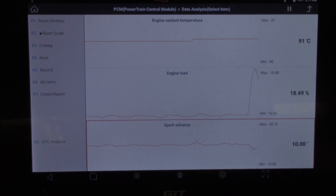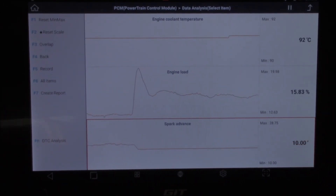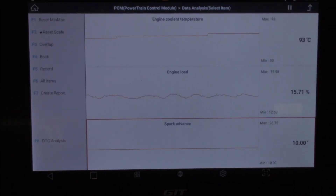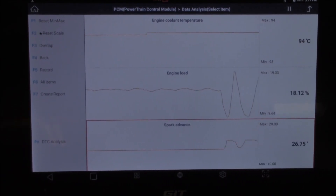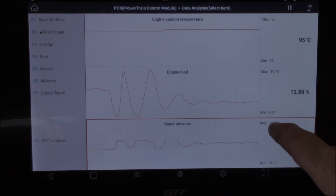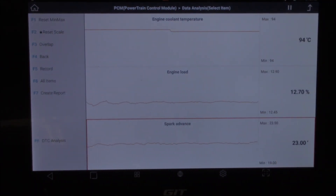I'm just disconnecting it now. What has it done to our ignition timing? It's gone to a base setting — nailed it right down to 10 degrees and it's not changing whatsoever. You can see it's being held at 10 degrees. So let's hook up that vacuum hose again and see what it does. I've just reset my min/max scale. You can see it's 10 degrees. Just hooking it back — and we're back up to adjustments. We can see it going backwards and forwards. Our maximum was 29, our minimum was 10. Even after resetting the min/max, 19 degrees is the minimum. So clearly there's a relationship between a lean mixture and the amount of advance you can put into the firing of an ignition coil. And that's why a knock sensor is so important on ECU-controlled high-energy ignition systems.